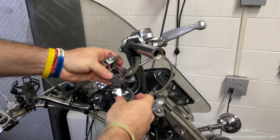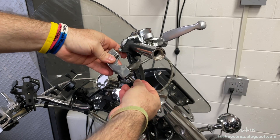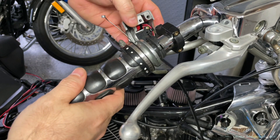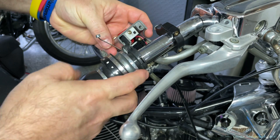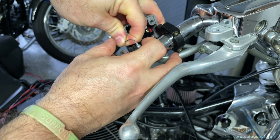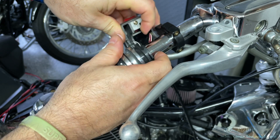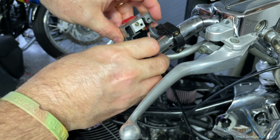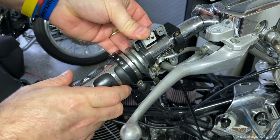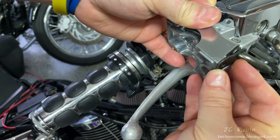This entire cable will need to be spun around the shell — I don't want it tightened all the way; there needs to be room for at least one rotation to set the direction back towards where it'll be dressed into the bike. Showing the front shell first because the camera is right there — I put that cable in position on the grip, slides in, then push the slack back down in the cable a bit, bring the shell around so the cable is in the groove. Now the back one slides in the back shell, and I need to get that flat-head screw reinstalled because that's what holds the cable in.